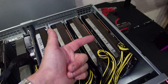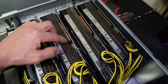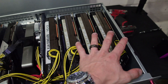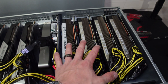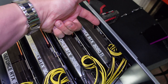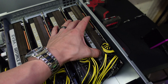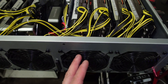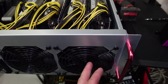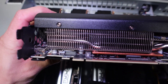What I'm going to do first is remove these fan shrouds. I want to put this thing back together and test it like that. I also want to adjust these over to the left and put the 3070 over here, because the memory on the back side of this 3080 Ti is what really gets super hot. Putting it over here puts it in a more direct path of the fan, and being way over in the corner it's not so much in the center, so it would be in a better position.